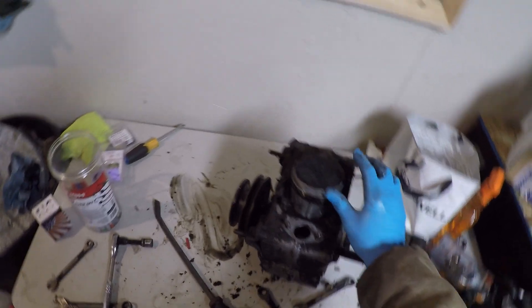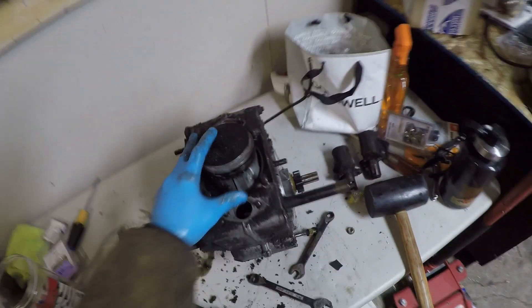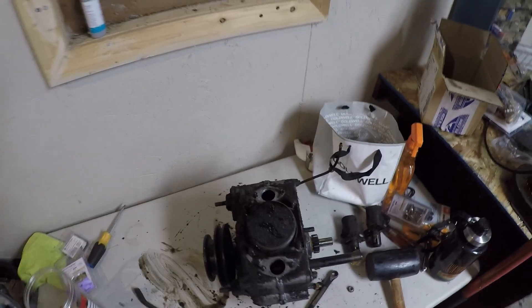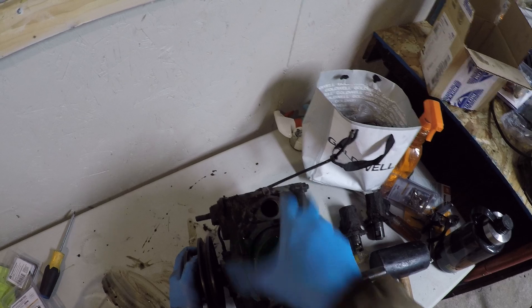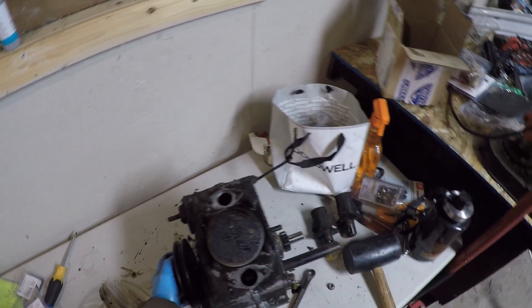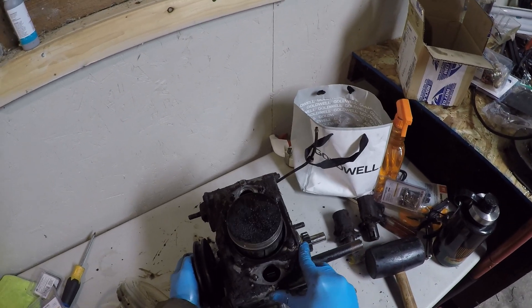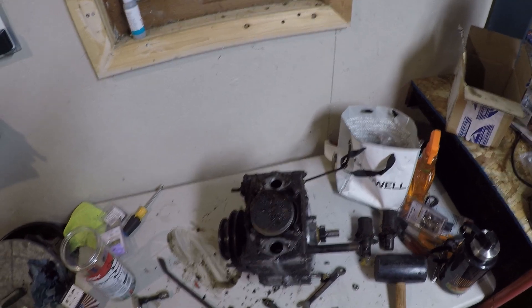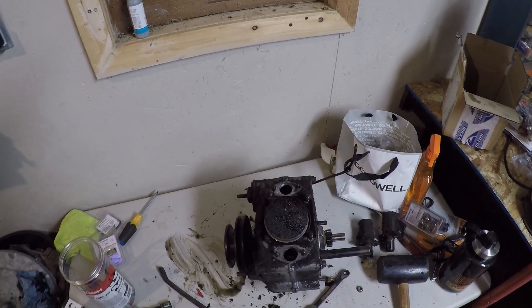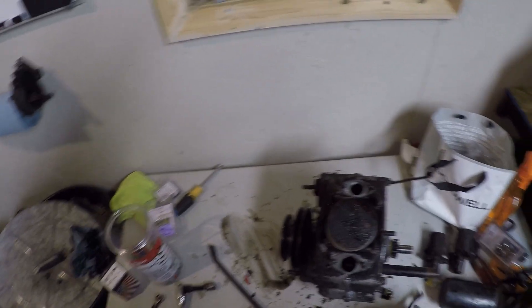There's just a big groove in this piston — that's wild, you never see that. So it looks like whatever's got this engine locked up is still in there. From what I can tell by this motion, it's a lower connecting rod bearing that froze up on us. But that's neither here nor there — we're not going to use anything here.